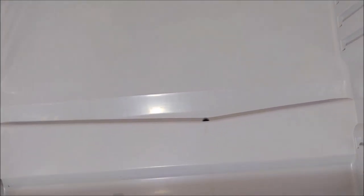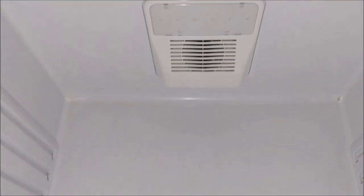This fridge came to us with no gas in the system — it was completely empty. I removed the suction from the compressor, and it's got two capillaries. I put a gauge on the capillaries and pumped up some pressure. Right in the top corner, the gas is blowing out — there's a massive leak inside the internal cold plate. You'll never reach this cold plate to fix it, but the client loves this fridge and wants me to repair it. I'll show you how I repair these fridges.